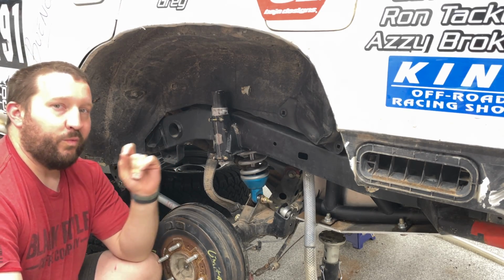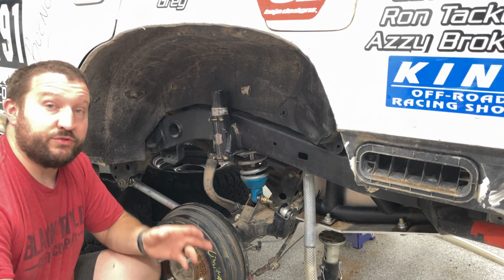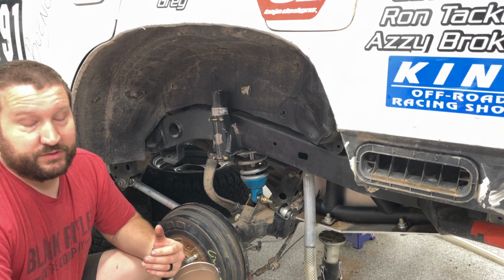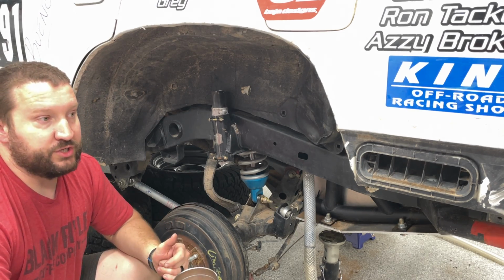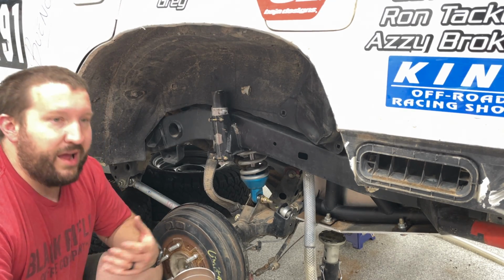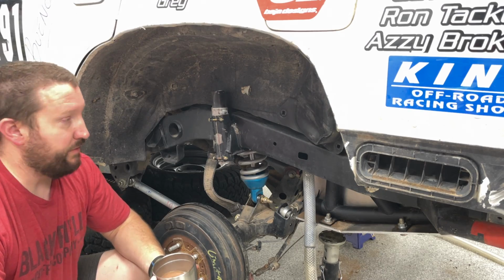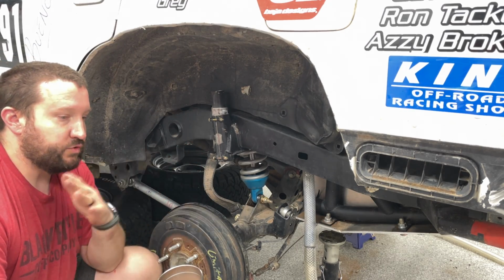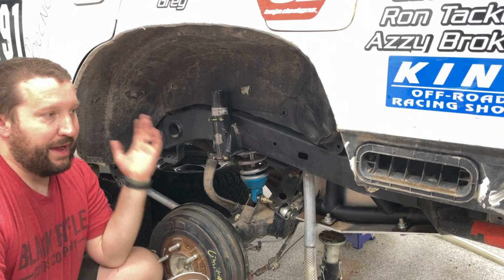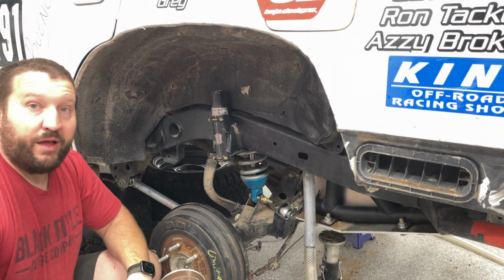And if that's happening, what else can we do to improve it? A wider axle, to have the rear axle actually match the track width of the front. The truck would drive so much smoother right off the bat. One of the biggest drawbacks of long travel suspension with off-road cars, like what you can buy commonly off the shelf, is that the axles in the back are skinnier than the front, so you hit the obstacle twice. You drive over something with the front, and that will make a track that ideally your rear tires follow. I didn't get that luxury. Every time that we would hit something, the front track width was so much wider than the rear that there would still be silt or sand or more rocks in the way for the back to hit. If we just got that wider, that would make the truck drive smoother. If we could push this back, we could drive faster and safer.